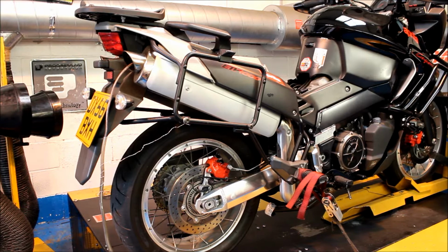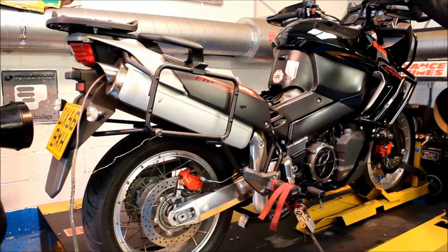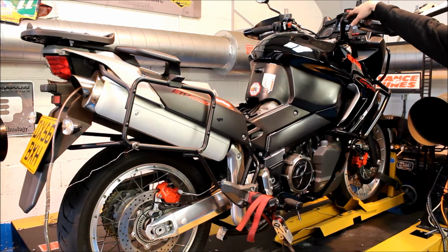And are you concerned with how the engine runs? To be honest, and have you had a run of it yet and see what it does? I've had a quick ride up and down, see the fault the customers described, snatchiness, jerky low down, and it is all of those things. But there's no problem. I've been looking on the live data, looking at what the ignition mapping's like. It's horrendous. The fueling won't be good either.